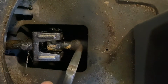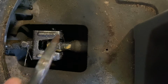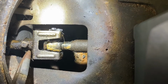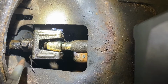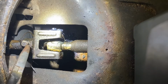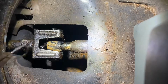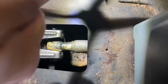Okay, to get this shift rod out through the front of the car, I've got to detach it from this coupler. So there's a grub screw here that holds it in snug. And one of the old tricks, I guess, is this baling wire. Of course, this one is broken, but this baling wire wraps around the input shaft and goes through this grub screw so that it can't untwist on you. But this baling wire is already broken, so pull that off and get it out of the way.